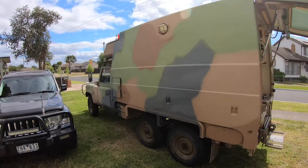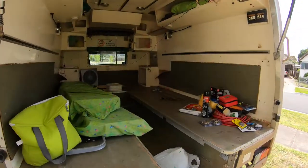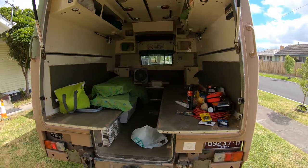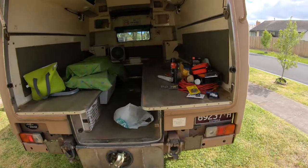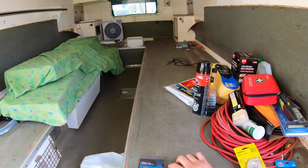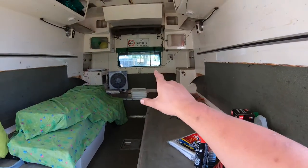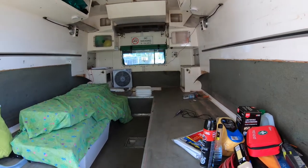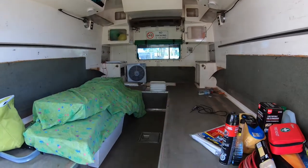It's windy and we're looking at a Land Rover Perenti Ambulance - a new arrival in my household. There's even a two-part episode on this, links are in the description. We've got a bunch of deliveries and the very first thing I want to do is reinstate the 24 volt alternator. They normally came with both a 12 and 24 volt, but the previous owner removed the 24 volt alternator from the system.